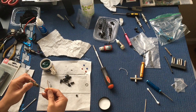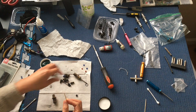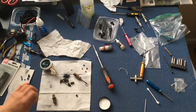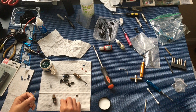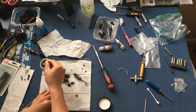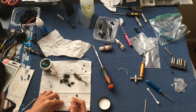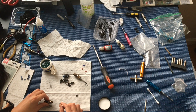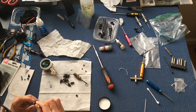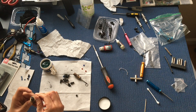The real function of this grease for the o-rings is to provide lubrication on the shock shaft and the o-ring, easing wear and tear on those o-rings. You could also just use silicone shock oil or your usual shock fluid, but we decided to give this RaceTech Ultra Slick Grease a shot.